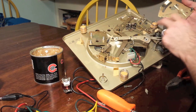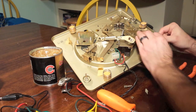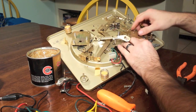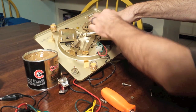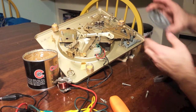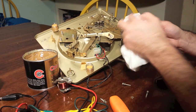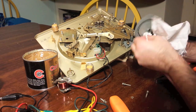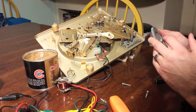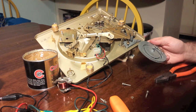You'll see it — that shiny piece right through here — there's a linkage that sits there that will need to be lubricated, and it's this piece right here. Remember, take your time, don't get frustrated. The minute you get frustrated is the minute this stuff will no longer work. I've got that linkage — it was getting caught. A little more, snap ring — boom, I can't believe that just snapped in. Let's come back to this hub. It has grease in there, but the old grease is hardened and will impede how this works, so I need to remove the old and apply a tiny amount of fresh grease, working it into a few different spots in the groove.